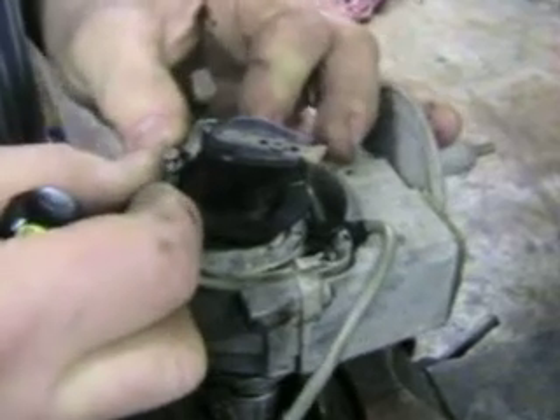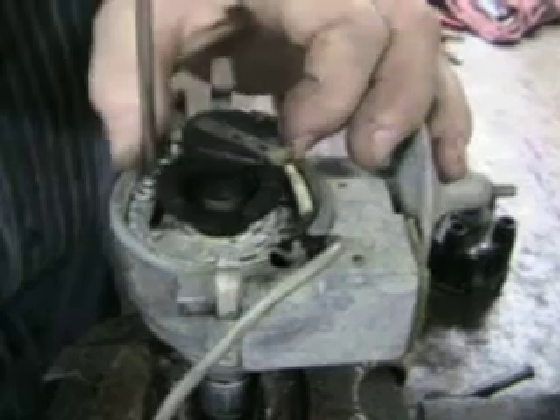The trick here is to loosen up these brackets and allow the eye to be positioned correctly. In this case the eye is about right here — we're breaking right here and our rotor cover is pointed up at 45 degrees towards the number one point on the cap. These things are dangling way out on the end of all these brackets, which doesn't make sense.